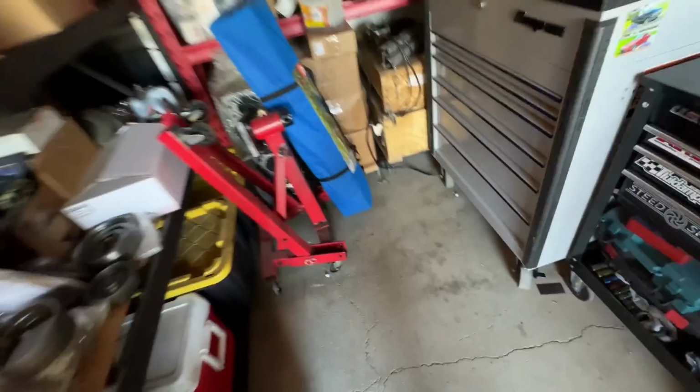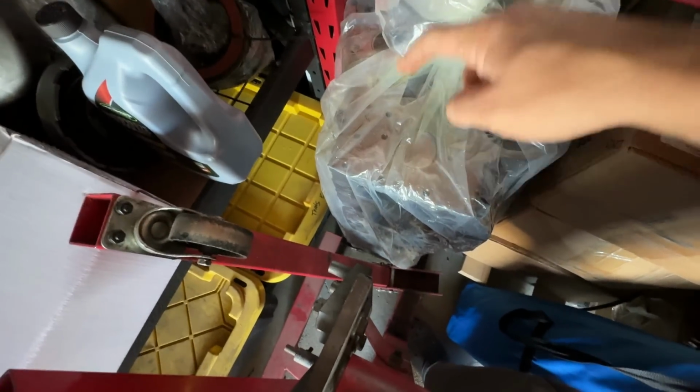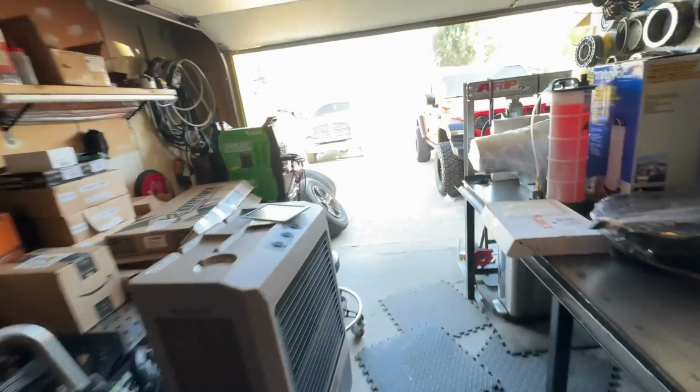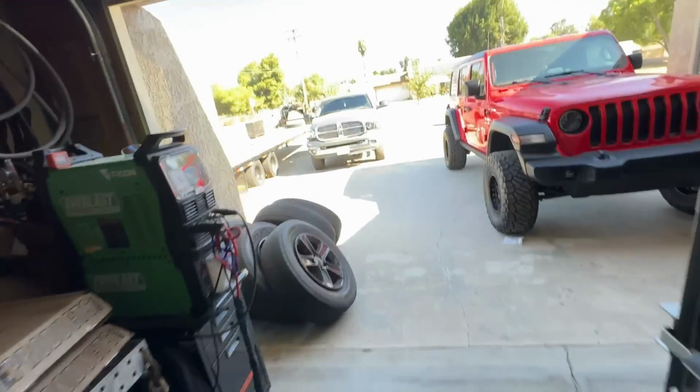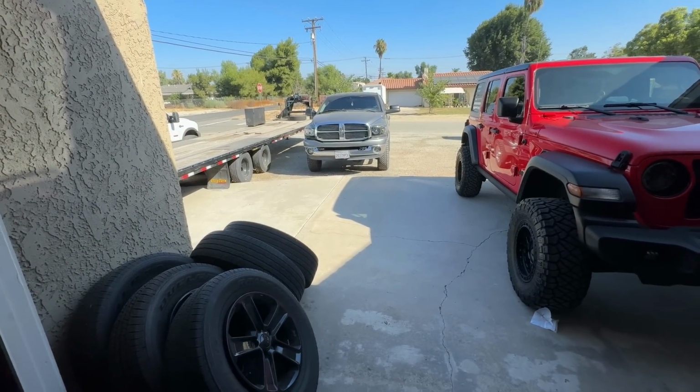Now, taking you guys back here, all right, now I know this is the front of the block technically, but this freeze plug right here, which is also located on the back of the block, is the problem. It's what you got to knock out. Now, it is much easier to install this with the transmission out. However, it is very doable with the transmission in, and we're going to demonstrate that.